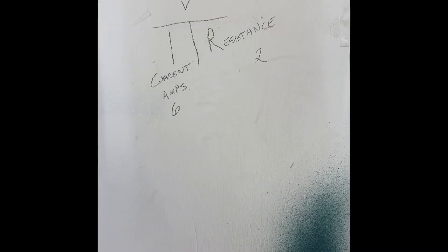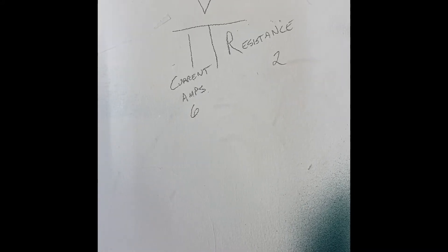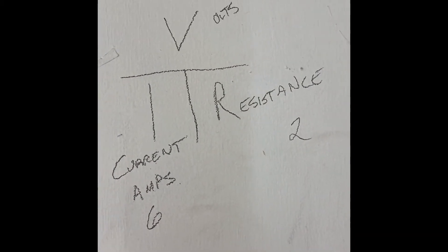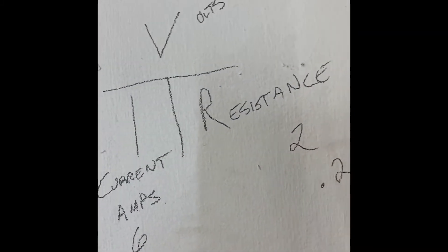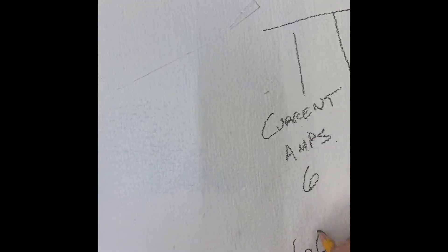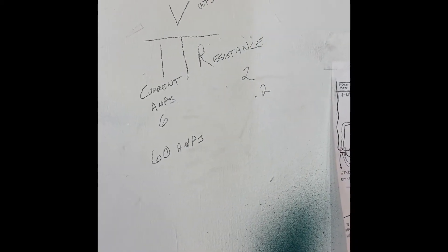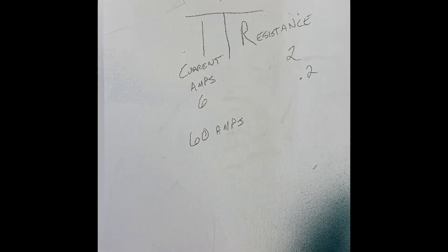So then the question is: why, if I touch that wire straight to ground, does it fry everything? I did the same thing and put my meter on the chassis about a foot apart, and it read 0.2 ohms. So 12 divided by 0.2 is 60 amps. That's why — if you put that wire directly through with no resistance to use up some of that current, it's going to push 60 amps through that fuse.